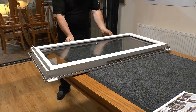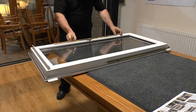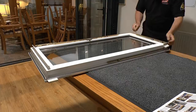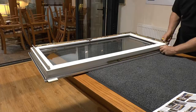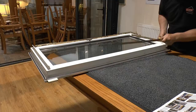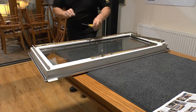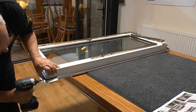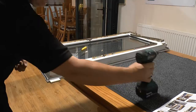We will start with where the handle goes through — that comes out neatly — and then the bottom gear, the top scissor stay, and then the corner drive, and finally the rear drive that goes down the back of the window. So that's everything removed. And finally we need to unscrew the bottom shoe, and we can remove that.